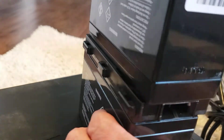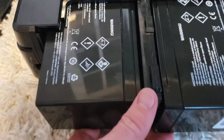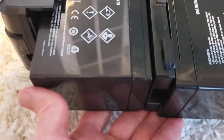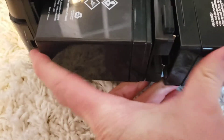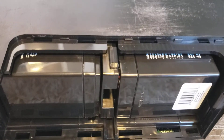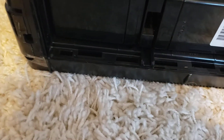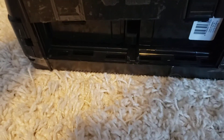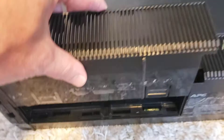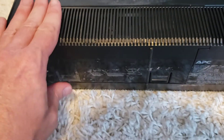These are going to go into the top groove. Now we're going to put it in the unit. As you slide it in, line it up and hold everything together a little bit, because there's really nothing keeping the two batteries together. They're going to get stuck a little bit — just jiggle them. There we go — they're in. Now see if we can get the cover back on. The cover's a little tricky; make sure you start way out and come in, then snap it on. And that's it — that's all there is to it.